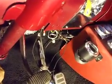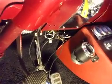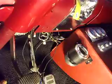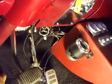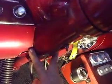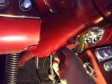this is a clamp here. Now your clamp may differ, but basically it clamps and holds the steering column against this brace. This brace is bolted to the floor with 2 bolts, but you don't need to worry with this brace. Just undo that totally. That'll loosen it on that end. Then there's a little C-clamp here, like it's got a bolt on this side and a bolt on this side. Once you undo that, the steering column will be almost free.